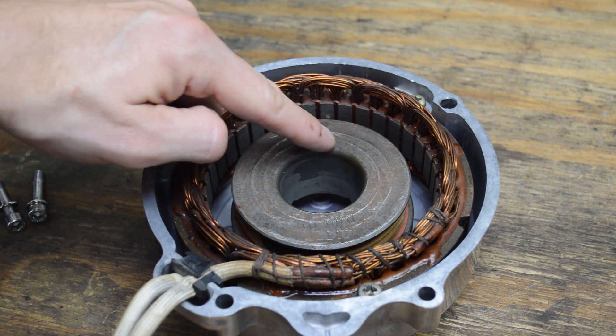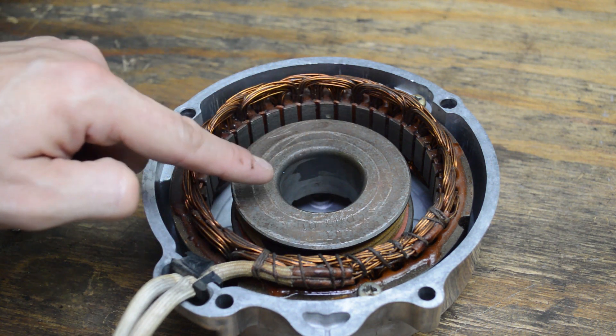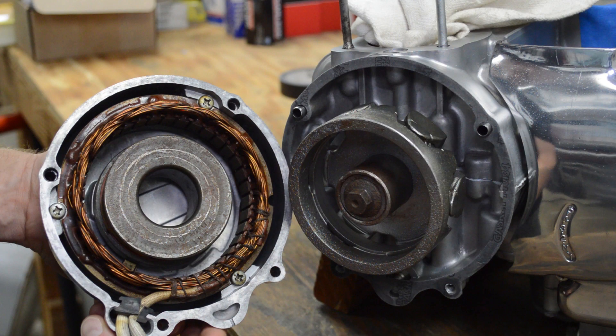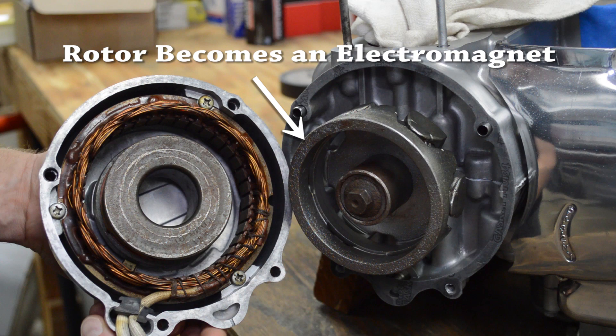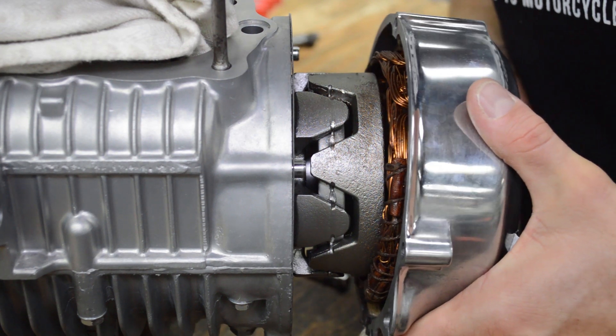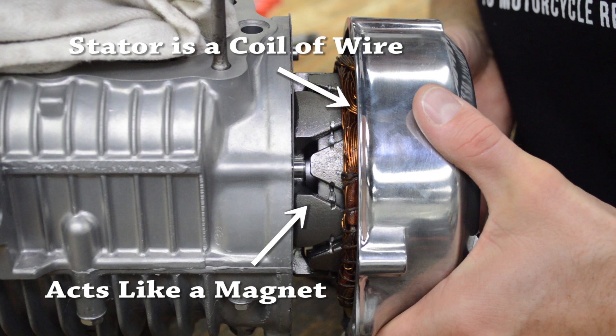So let's see how these two simple principles apply to the motorcycle components. This particular alternator has a third component, the field coil, which is also stationary. This is a coil of wire similar to one wrapped around the nail you saw earlier. The rotor acts like the nail in the experiment, so when battery voltage is applied to the field coil, the rotor becomes a large electromagnet. Notice the unique shape of the rotor — this shape allows the poles of the magnet to be arranged in an alternating fashion. Now, going back to Faraday's law: if we rotate the rotor, which is now a magnet, voltage is created and power is produced in the stator, which is a coil or wire loop. So that is basically how a motorcycle alternator works.